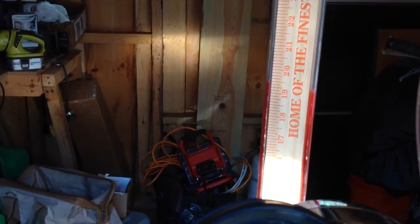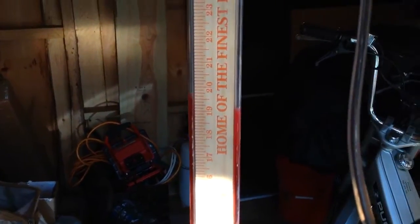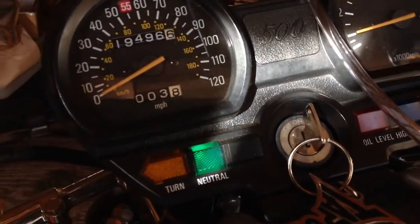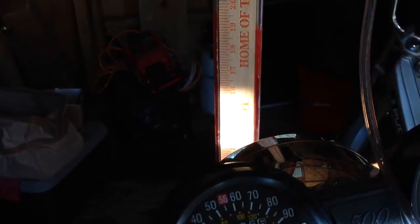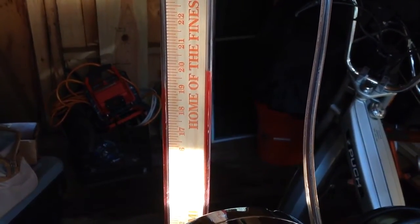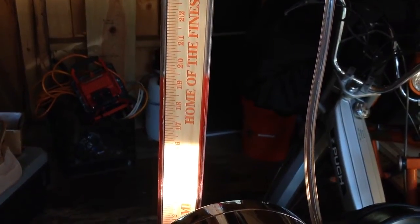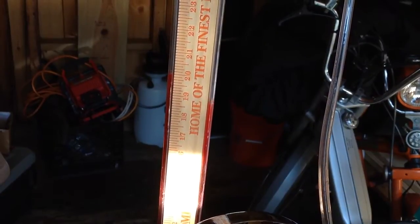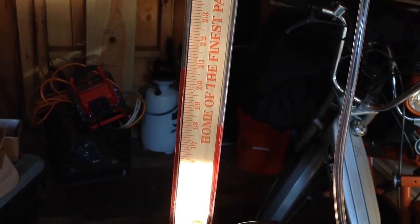I can get them kind of close here. See, we're dancing around the same area, and I know I can't get it perfect, but as soon as I start to raise the RPMs, so we're a little over 1,000, I previously had set it for 1,100, but whatever, if I give it some gas, you can see the front one has more suction than the other one, and then they kind of even out like this.